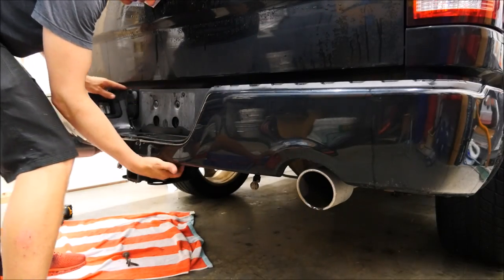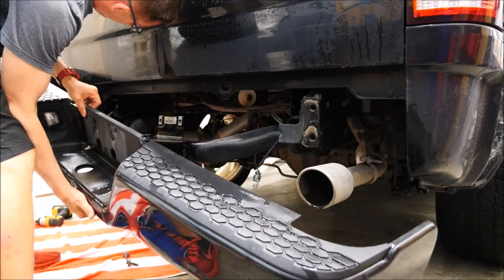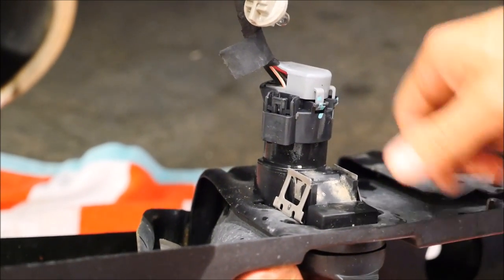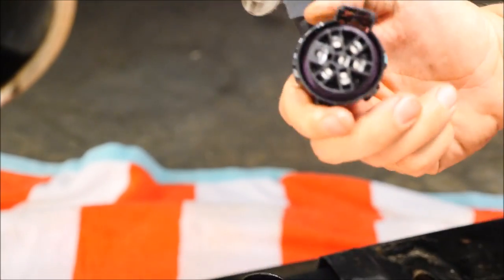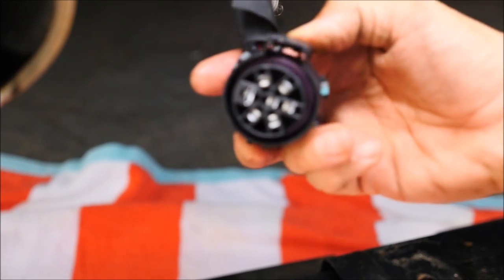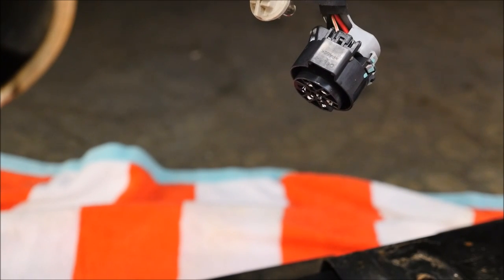It's pretty lightweight, so I'm just going to lift up here and pull it out. When I do that, remember your trailer hitch light is here and we need to remove that. The last one I did was a pain — it was on a 3500 and it had two tabs left and right. This one looks easier — you're going to press this tab here and pull it off. That tab is what you've got to press to pull it out; the bottom is just a slide. So we got our bumper off now and we'll start disassembling it and putting the stuff on the new bumper.